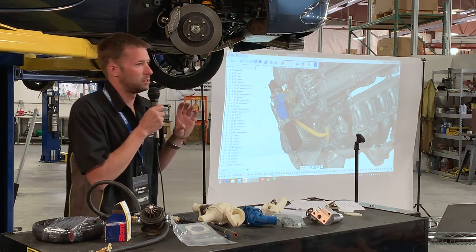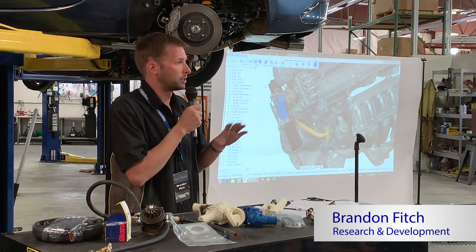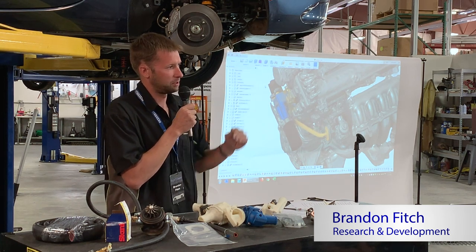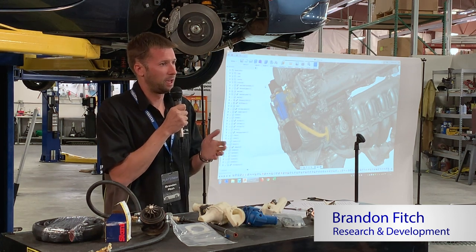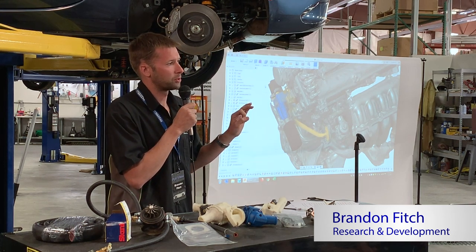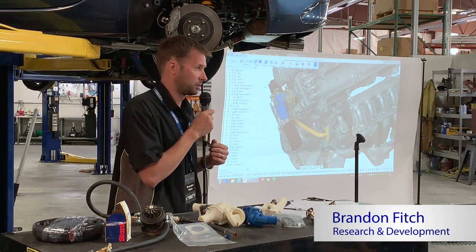The M-Tuned kit is quite a bit smaller in terms of flow area. They clearly had a three-axis mill that they built it on. So there's not very much contouring inside. There are a lot of steps. And if you don't remember, I've got one I can show you. And the thermostat is remotely located. So you have to drill a pretty big bypass hole in order to get enough coolant to the thermostat to make it react in a timely fashion, basically.